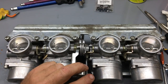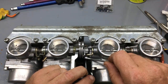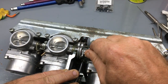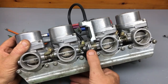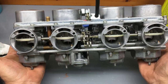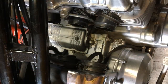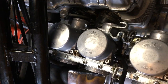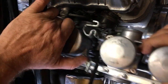With everything back together, the individual throttle plates have to be adjusted so that they all open in perfect unison. The amount that they are open can be adjusted by the throttle adjustment knob once the bike is together and running. Finally, the carb bank is back as a single unit and can be installed with all the new gaskets in place and the adjustments set to their original settings. If everything is done correctly, the bike should start and be really close to being in tune.